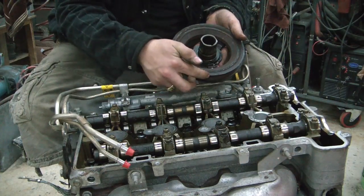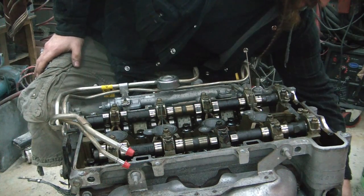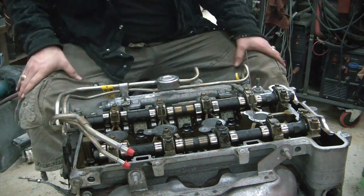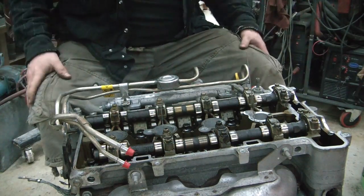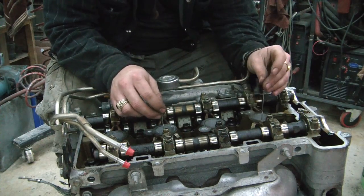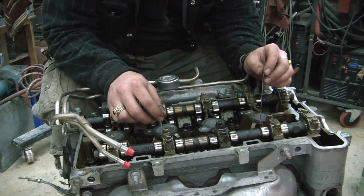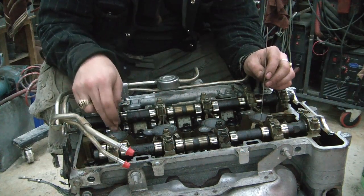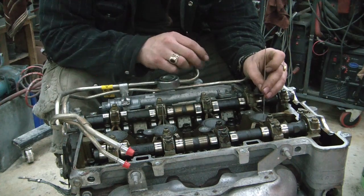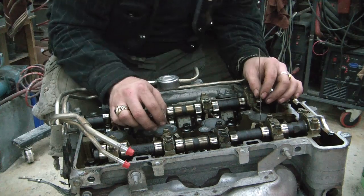You can see it right there. I'm pretty sure we got this where it needs to be right now, but we're going to spin it clockwise and watch these rods go up and down. The firing order on this is cylinder one, three, four, and two. So after number one fires at top dead center, this one should be coming up, and we believe this is at TDC right now.